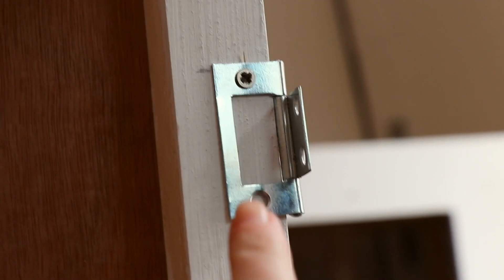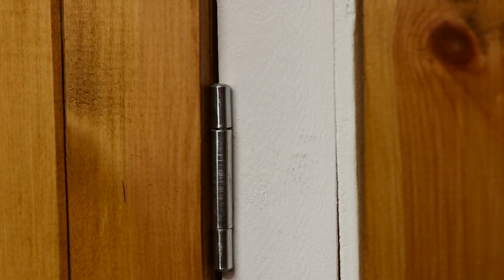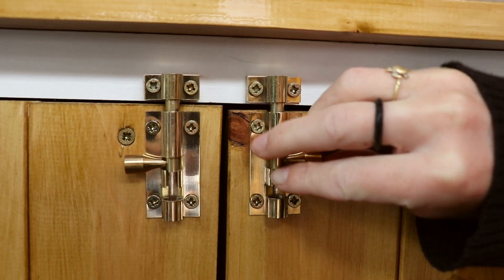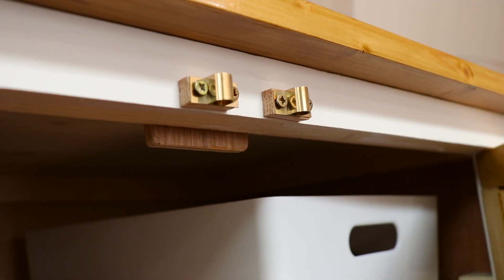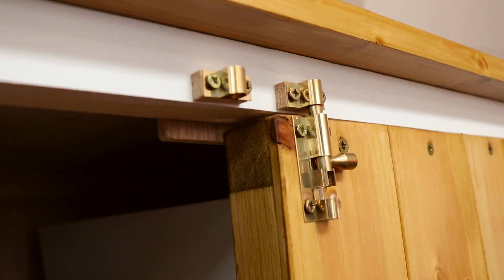We originally wanted to use some hinges like this because they provide an invisible hinge so you never really see them, but they didn't really work with our framework so we had to adapt, and Dave found some in his garage that he kindly let us have. To keep the doors shut we added these gold locks here and we really like how they turned out — they really match our colour theme. Since the tongue and groove is slightly raised from the frame we needed to put a little catch in the back for something for the door to close onto, and we also had to put a little bit of ply underneath the lock. Now it fits perfectly and doesn't rattle when we drive, so we're really happy with that.